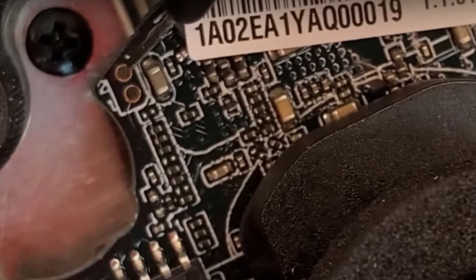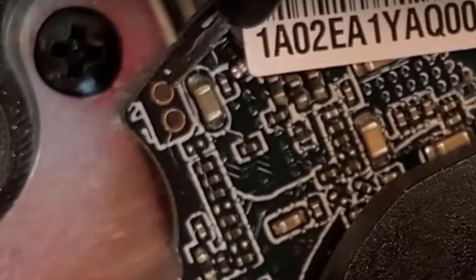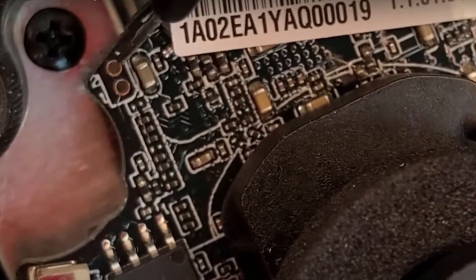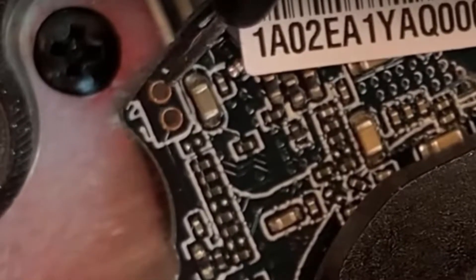Let me make a little zoom. On this part of the bottom, you can plug a single wired cable and then by pressing — consider it as energizing — keep the cable inside for 25 seconds and the camera will be reset. That's in case the camera doesn't support any reset button. You can put this cable in any one of the holes you can see on the main board, besides the lens.